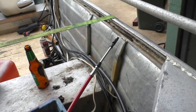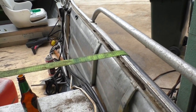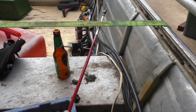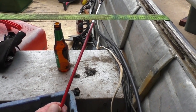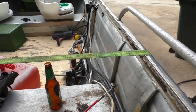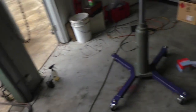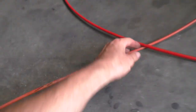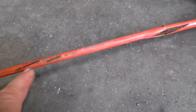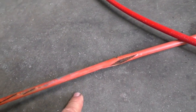When it comes to feeding the cable through, you've got quite a lot of choices. You can run it through the inside of the top gunnel — that's quite a popular place — or down under the seats. The outer casing doesn't move at all, so you're free to have that in a tight space or cable tie it to something else. Just be aware that if you put it between a rib and the hull, when the boat's moving there may be some flex and you may start chafing the cable, so make sure it's pretty protected. On this old cable you can see a few places where it's quite split, which can happen if the outer casing gets stressed and lets water in.